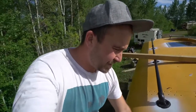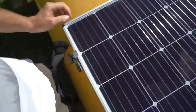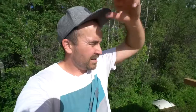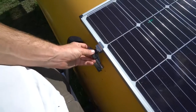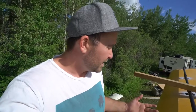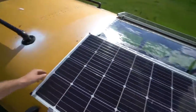We're not going to do a complete walkthrough of what we're doing because it's a little advanced. We're essentially bolting the brackets into the bus, and the reason is that we have the entire bus stripped out. So if you ever need to replace a panel, we'll just take it off, but these bolts will stay pretty much forever. This isn't the typical way you'd install solar panels, but if you do a complete gut of your bus, I recommend it — hop on over to Navigation Nowhere's video for that.